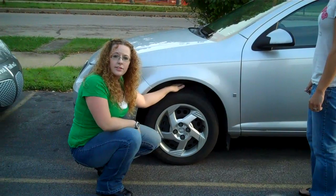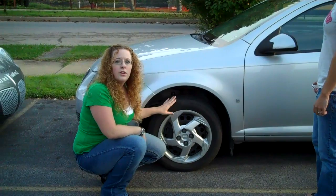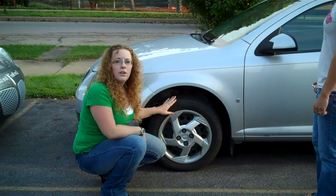When you see the balding on the outside, it's under-inflated. If you happen to notice balding on the center, that means that you're over-inflating your tires. Again, make sure that you are checking these every month. When you see your tires like this, it is time to go ahead and get some new tires. And that wraps up our conclusion of tire pressure and tread depth. We hope that we at Franklin Insurance have given you a little bit of education.